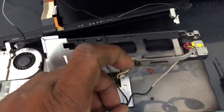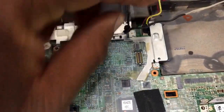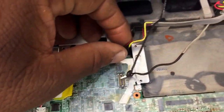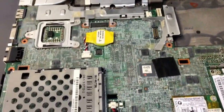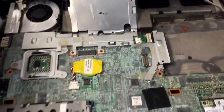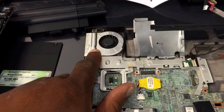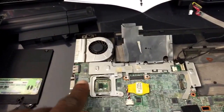Which is pretty much going to look like this, which goes there. We have another cable here that we might as well go ahead and take loose with the motherboard, which leads to the power jack. This power jack is plugged into the motherboard by a black cable instead of being soldered, which is a good thing. Now we're going to move the LCD assembly over to the side. It appears that everything is ready for the motherboard to be taken off. Here is the internal fan — the casing falls up under here, and when we get this motherboard out you will see the bottom side of it.